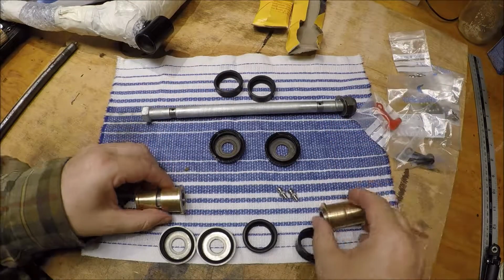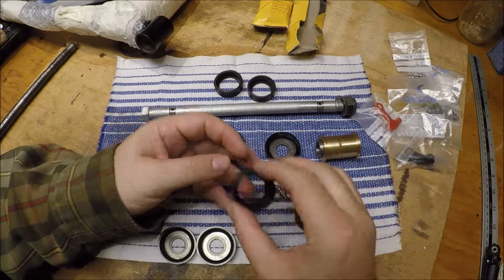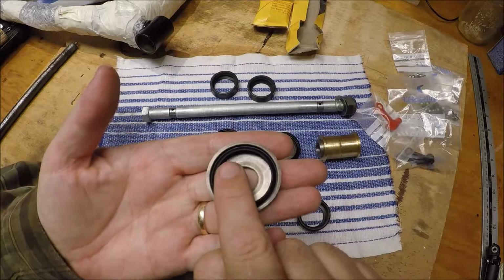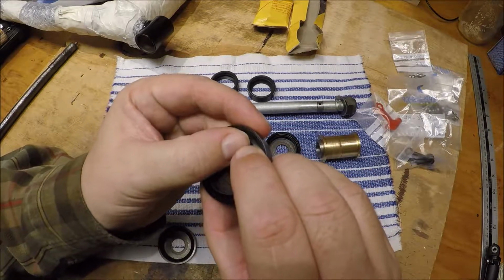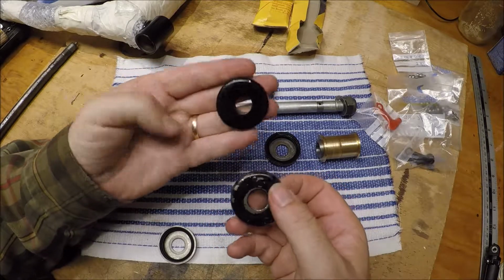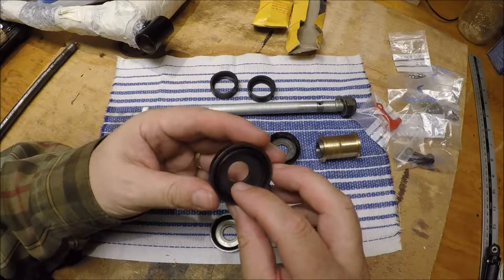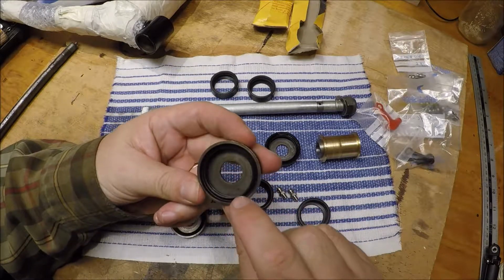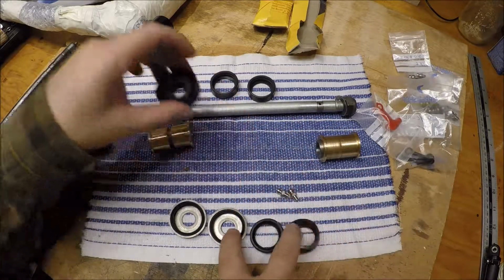When I got the new swing arm from the US, it came with the seals, and to be honest, they look pretty good. Nice and flexible, nice and round. In here, I don't know how well you can make it out, there's a rubber seal, and if I recall rightly, this one when it came off had a tear, a rip. Again, it's there, trust me. So though these ones are nicely painted, I reckon I'm going to fit the ones off the swing arm from the US. The seals are good inside, it looks nice and tidy all the way around, no splits, the rubber is still flexible. So I'm going to fit these ones off the US bike.